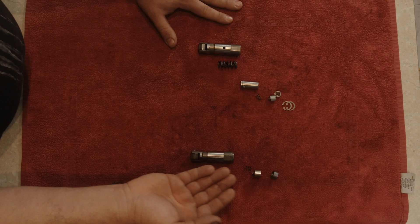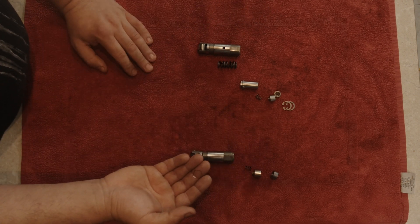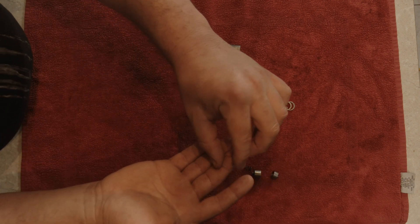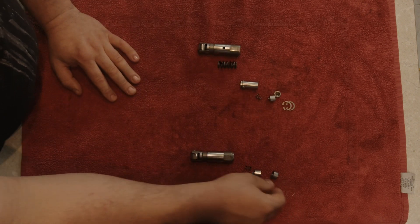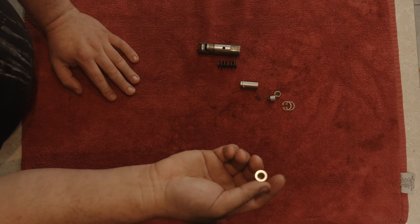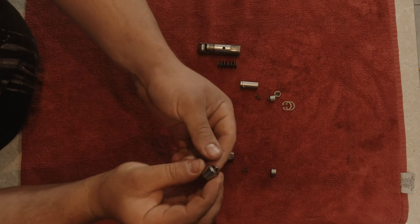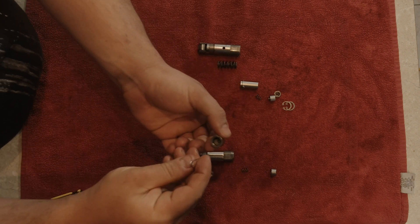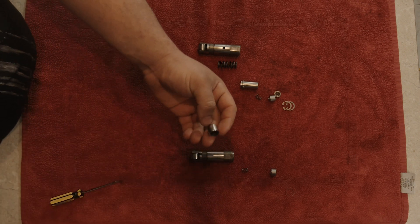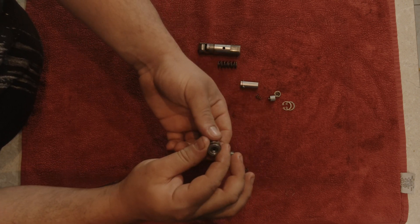You can instantly see that the non-MDS and the MDS lifter have different components within — some are similar, some are different. We begin with the pentagonal circlip which holds in all of our components. We have the receiver cup for our push rod located on top, and then a small chamber with a small check valve. At the bottom there is a check valve that allows oil coming in from the push rod through the hole inside the cup to fill that chamber.